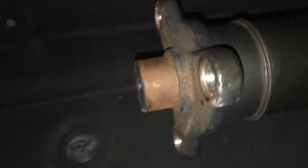And I didn't take any of the other pieces down. They say, oh, you have to take this down, you have to take that down, you have to take everything down to get the drive shaft down. All I do is disconnect it. I push it way up in the air like this, and then I slid the transmission under it. Very easy. This is the first transmission I've done